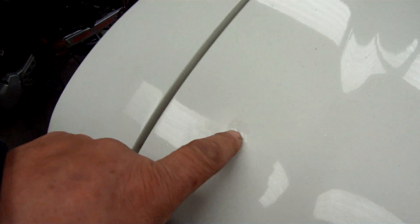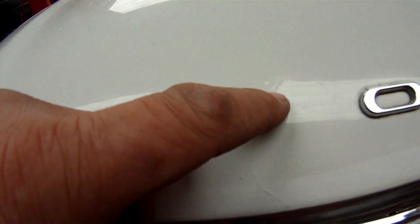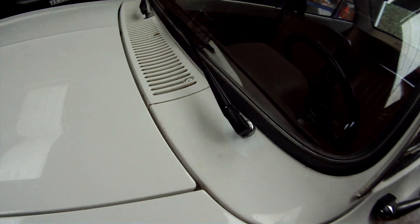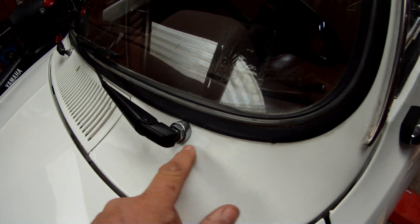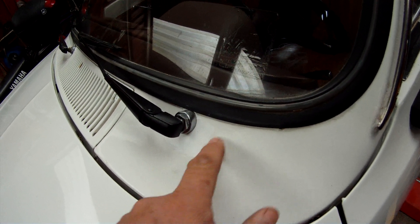There's a blemish there — a little bit of rust creep coming through, a little line out of the trace. The wipers didn't work when I got the car; the mechanism had fallen to pieces inside and actually burnt the motor out. So I replaced the motor, and while I had the wiper mechanism out, there was just a little bit of surface corrosion at that point, so I treated that and put some paint on it.